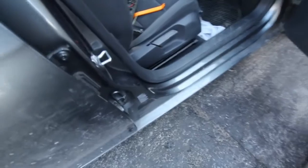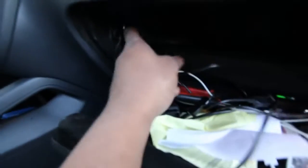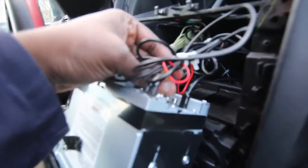I run the wire through the inside and it's coming through right there. I push it through into the front, running the wires through inside here, up through here, into the dash. I already have an opening right here in the dash going to the stereo. I used a metal hanger to pull it all the way down inside and into where the reverse camera slot goes.